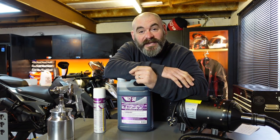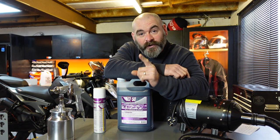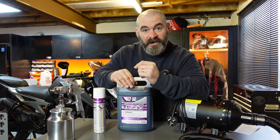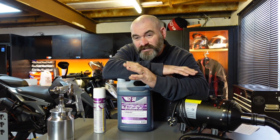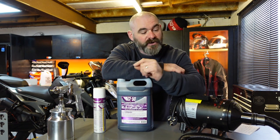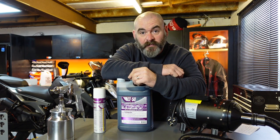In my opinion, there's three key things that you can do to keep your bikes pristine if you're riding them throughout the winter on the gritty, salty roads. Number one, make sure that they're protected against the corrosion in the first place by using a product like ACF 50, which I'll go into more detail about in a minute. Number two, after you've been out riding on the salty roads, it doesn't have to take a long time, but just rinse your bike off with cold water just to get the salt off. And then thirdly, make sure that you dry your bike. Then you're not leaving any moisture sat on the bike, so you're eliminating as much as possible the possibility of there being any corrosion.